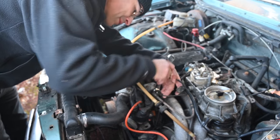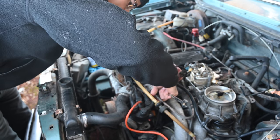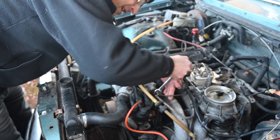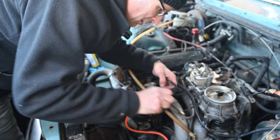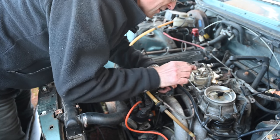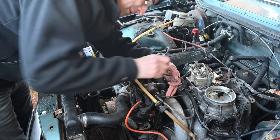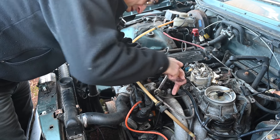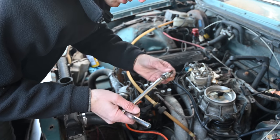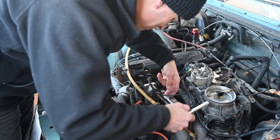Back with a 14mm spanner. That one's a bit tighter — and a bit petrolier, in every way. Let's follow this pipe back: this one curves here, big pipe down to a small pipe. This one feeds from the top one up there. When we were rebuilding it with Andy the other day, I said I thought the top one was the cold start feed — I was right, it is. This 5mm socket keeps making a break for freedom. At least if it did fall, I might be able to follow it to where the 10mm socket went.